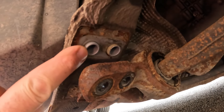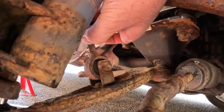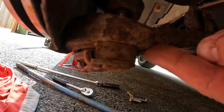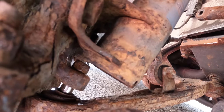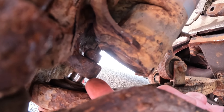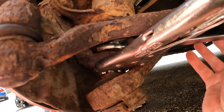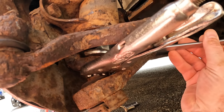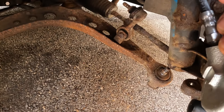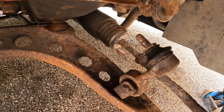Note the two locating rails here. At this point all the tension has really been removed from this because it's no longer connected at the anti-roll bar drop link, no longer connected at the back, and this lower ball joint is now relatively loose. I've still got that nut to remove, but now this has dropped down I can get something on here to hold it. In the end I needed to get some vice grips on here to grip it with sufficient tightness to loosen the nut for the last few turns. The nut is free — the lower arm is now completely detached from the hub carrier, the body point at the rear, and the anti-roll bar drop link.